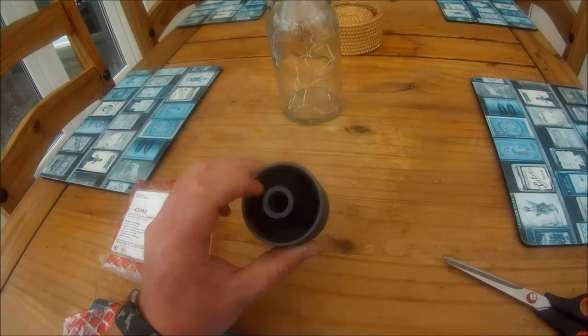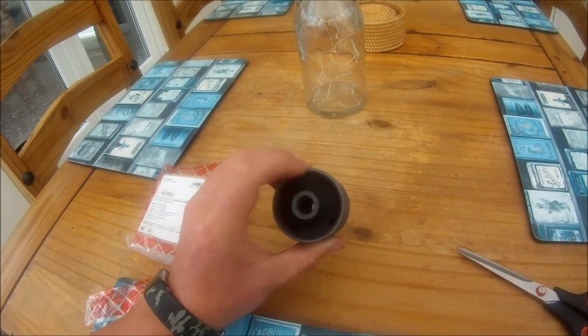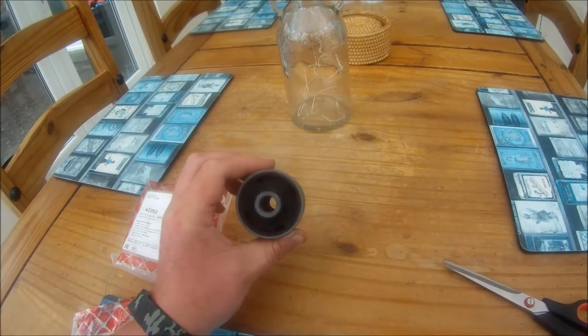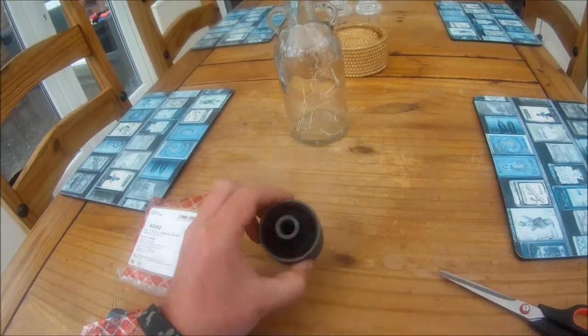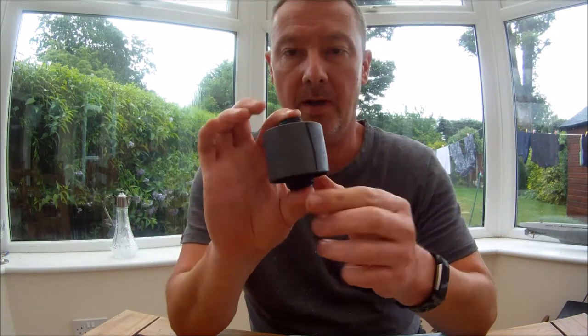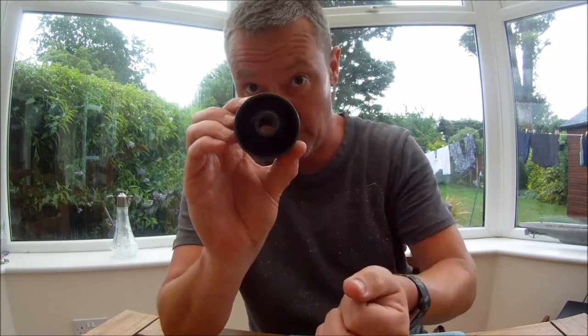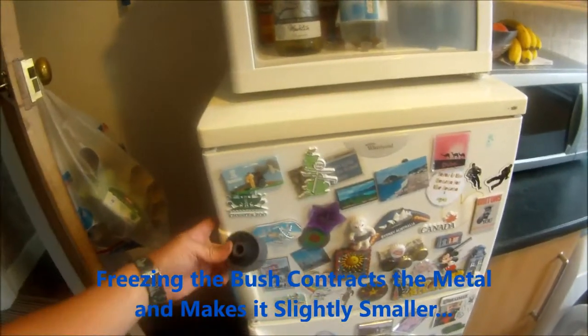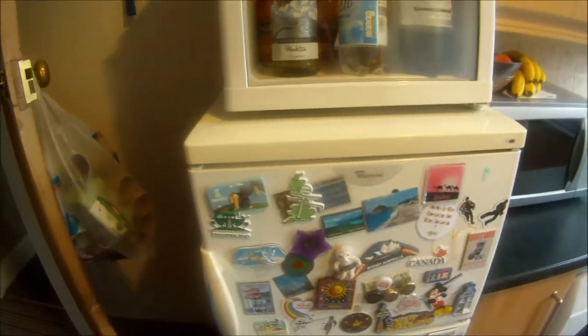The difference between the front and rear ones: the rear ones look like this - they've got slots cut out so the contact between the rubber and the outside ring is only at two points, and that's to allow for articulation. They're mounted in a specific way in the arms, which I'll show you later. First thing you need to do when you get these: get a black marker and put a couple of lines down the outside matching up to where the rubber contacts the outer ring. This makes fitting much easier because when pushing the bush into the arm we won't see this contact point, so it gives orientation as it goes in. Once you've done that, pop it in the freezer overnight.